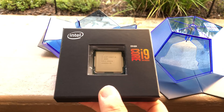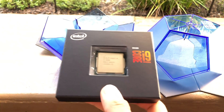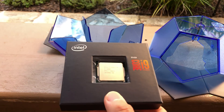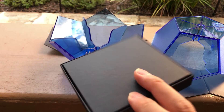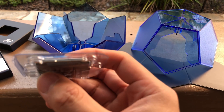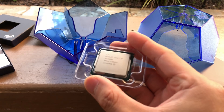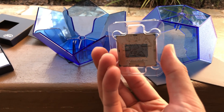I personally use the Noctua D15 giant fan so that I can run it on minimum RPMs with as quiet a speed as possible. Not really into overclocking, but this thing has been clocked even beyond its 5 gigahertz theoretical maximum. One other thing about this new chip is that it has a thermal cap that is soldered on, rather than in previous generations where people de-lidded these CPUs to apply their own cooling solutions.